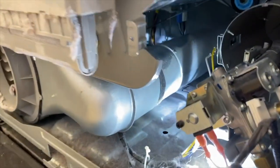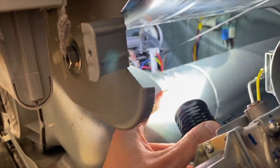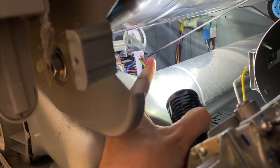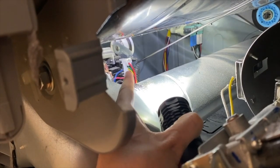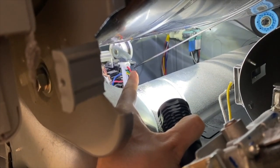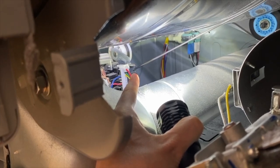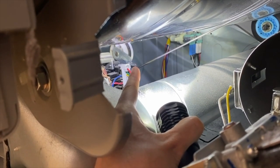Coming down below, this is probably the most tricky portion. You have your idler pulley way back there — that white circle or roller — and you've got your belt. Reach in and you'll notice a spring. Push that pulley away from you, which puts more tension on the spring, and carefully remove the belt from the idler pulley. I recommend taking as many photos as you can first so you know exactly how the belt goes back. There is a motor down below that it loops around as well as that upper idler pulley.